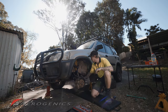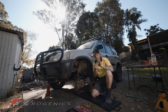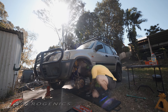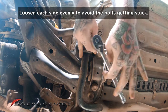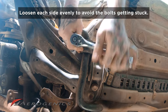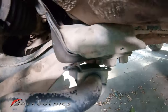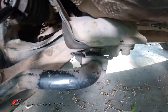With the wheel off, we're going to remove the sway bar first. Use your 12mm socket and probably an extension piece because the lower control arm is in the way. Just loosen the bolts a little at a time so it comes down nice and evenly. You'll notice the sway bar doesn't drop far — it's maxing out at the ball joint. That's the sway bar done; now we're moving on.